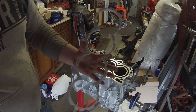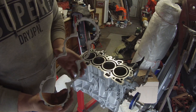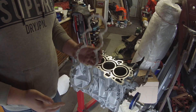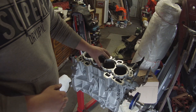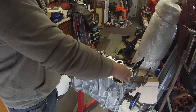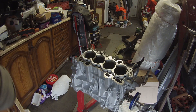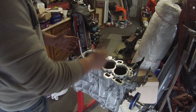This block guard sits under these sleeves. This side is slightly recessed — it has a groove and an angle cut onto it, which makes it easier to hammer in. It just sits in there nicely and just needs to be tapped in because it's an interference fit. What you'd use here is a rubber hammer and just tap around it lightly.